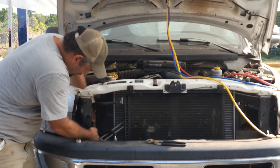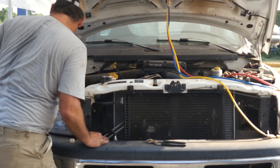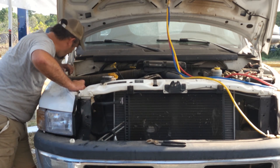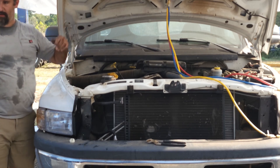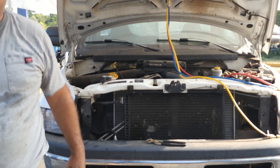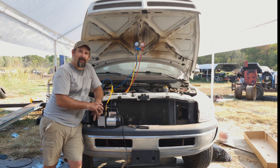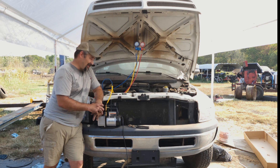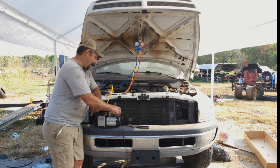I'm going to try to pull this a little bit and tie it to the truck frame member here so we get a little pressure off of it. That is in place. Let's go ahead and put some cooling in it. I'm actually going to pull a vacuum for about 30 minutes before I recharge this system. The oil should be good — I didn't change anything that had oil in it. So we should be good to go. I'm just going to fire up and vacuum this thing.